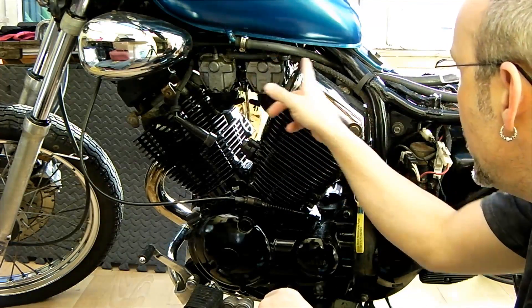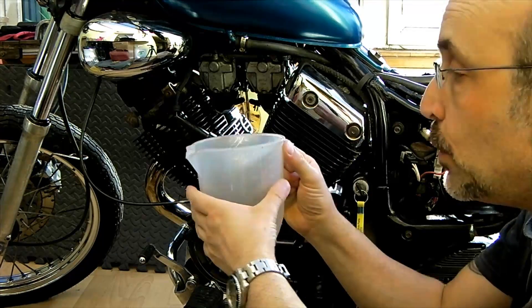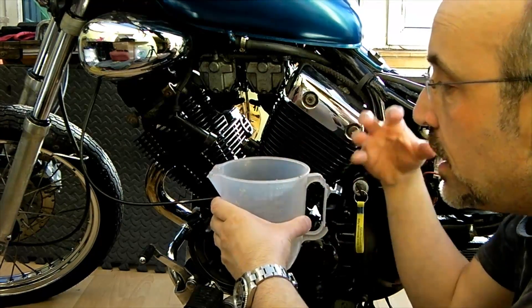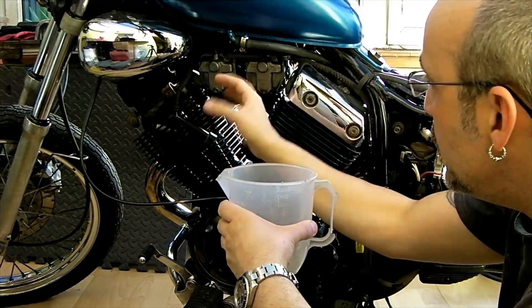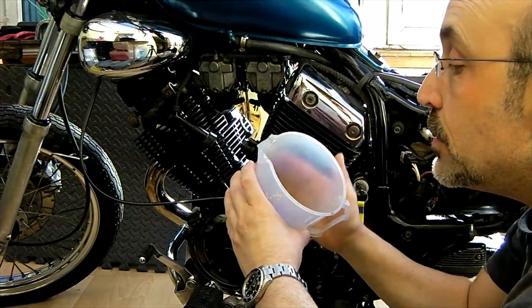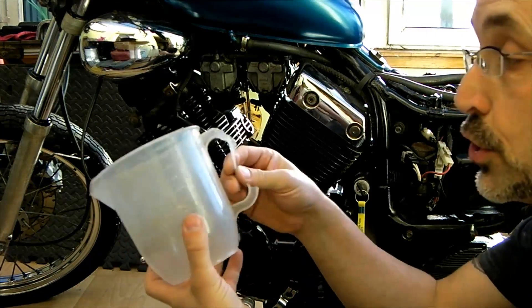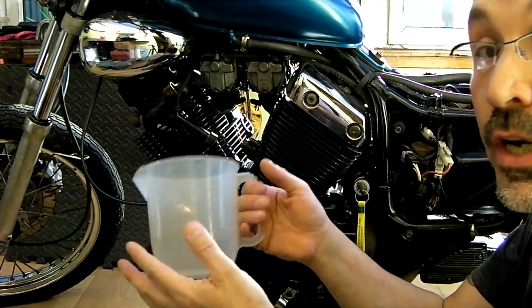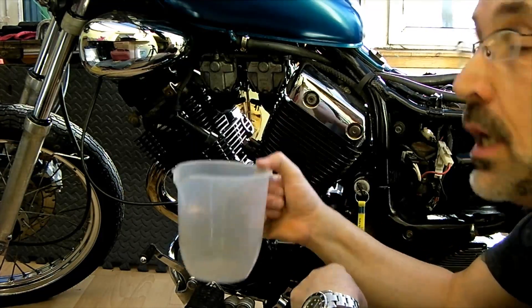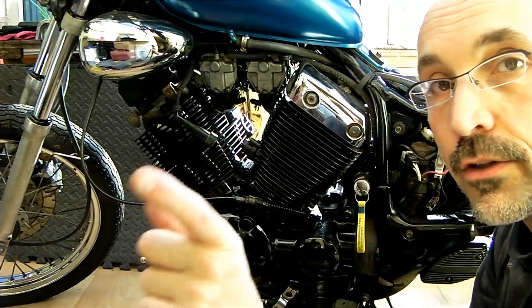What I'm going to do is take the fuel feed off the carburettors, turn on the ignition and start the pump cranking into this jug. When everything's cranking over it will pump fuel in until it feels resistance and feeds back, telling it to stop. When the carbs start to empty it'll pump back in again. Since there's no resistance it's going to pump continuously into this old plastic measuring jug, which has measurement gradients on the side so we can see how much fuel it's pumping out.